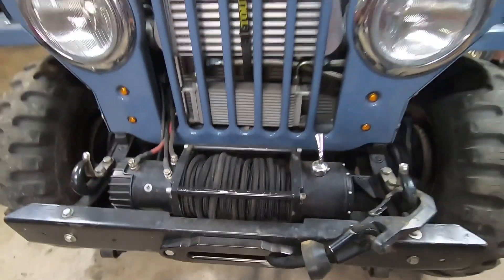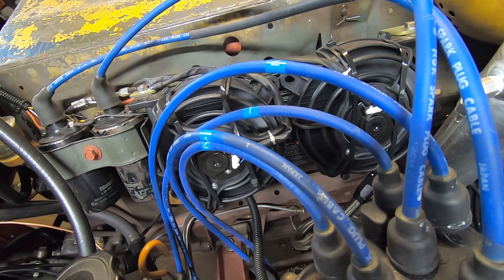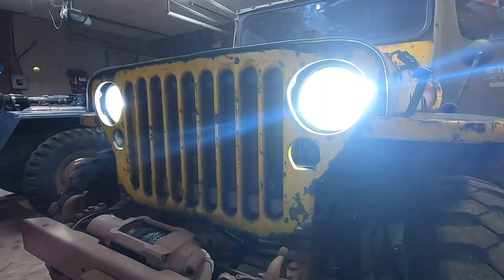You really have to take into consideration things like winches, electric fans, lighting, and blower motors. So when you're purchasing an alternator or setting up your Jeep or planning a build, you want to add up every electrical component that you plan to run, find out the amperage of that, and see what it totals. Things like fuel injection, headlights, stereos, fans — all those things have an amperage value and will contribute to your total draw on your system.